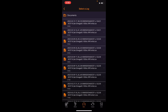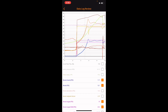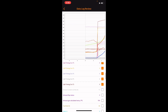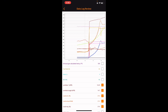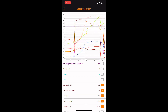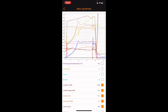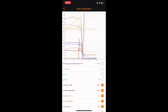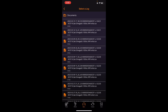Let's go over a few of these data logs and see what the intake air temperatures are. With ambient temp at 75 degrees, before we were on throttle, intake air temperature is at 93 degrees. Let's see what it does throughout this run — most of these are fourth gear pulls, some dipping into fifth gear. We seem to be holding at 93, tops out at 95, then 97, then 100 on this run. So it went up seven degrees during that pull.